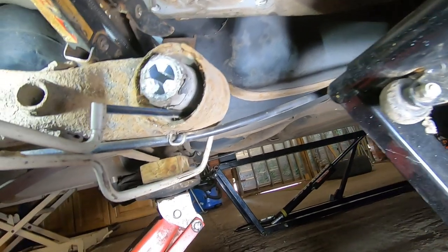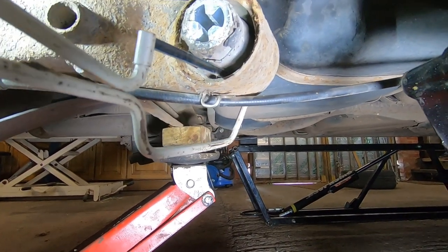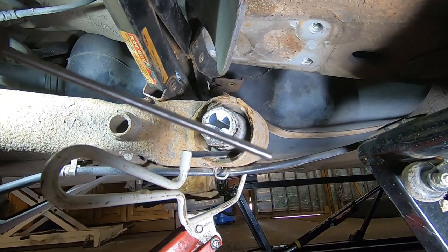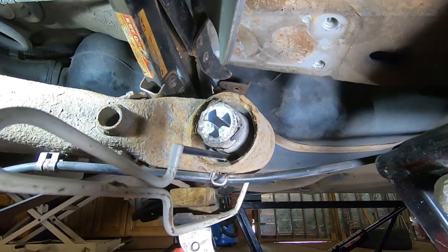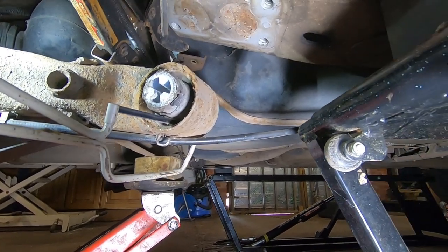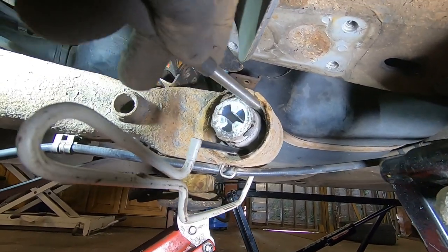So what I'm gonna do is cut two grooves, one there, move it over, cut another one, and then I'm gonna bang a pin punch through it to make a gap, and then that will sort of allow it to shrink a little bit. And then I'll use a big pin punch, which I've just dropped, this big pin punch, and then I'll just knock out the remainders.